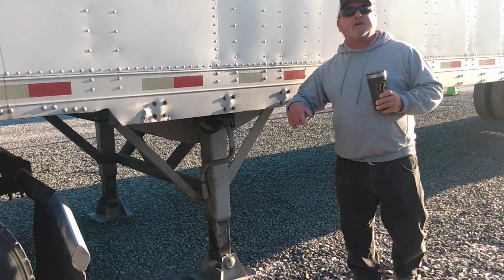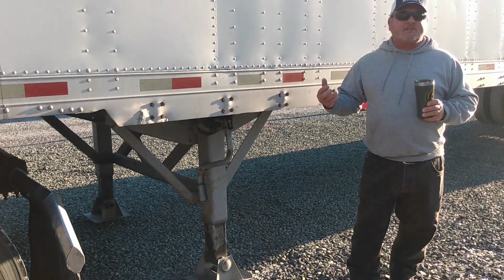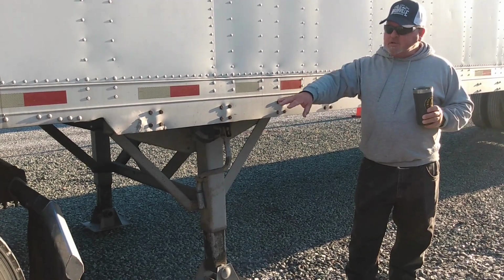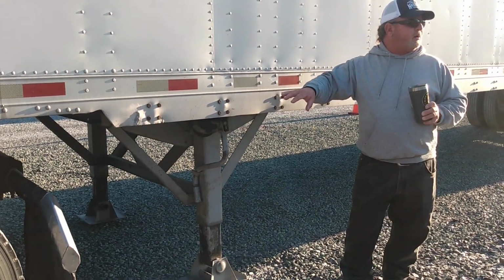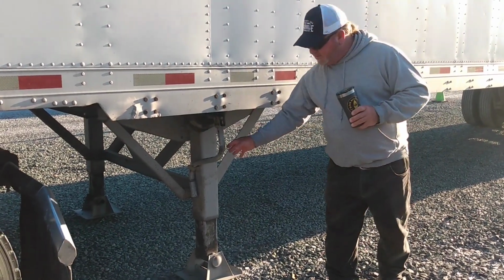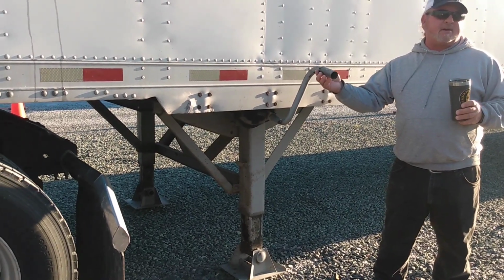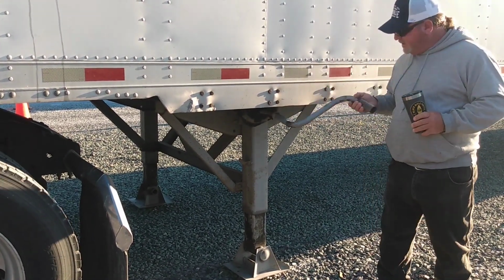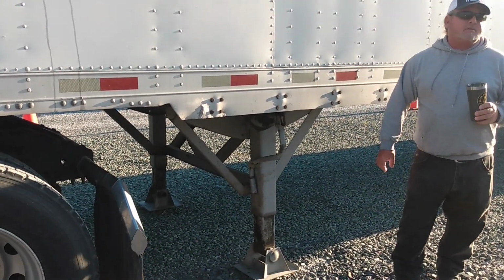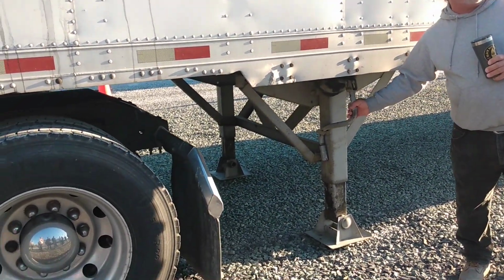Even on the drop yard, make sure that you take care of your handle. A lot of times when they put these things on a loaded line, once they load them from the plant, they put them all together. They don't use a regular truck to move them with. They use a spotter or a switcher. It raises them with air or hydraulics. They don't roll landing gears. So if you got that thing sticking out here like this, and they put this thing on a tight yard, they might put them 8 or 10 inches apart. You put another one 8 inches off this one, when you come to pick your trailer up, your handle's gonna look like a dish rag. All right? So always secure your handle before you go any further.